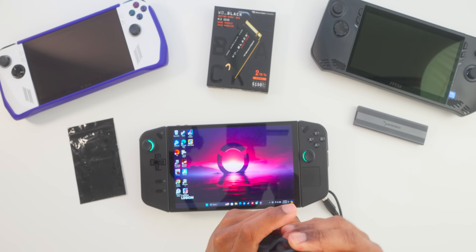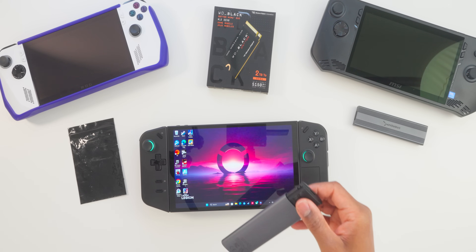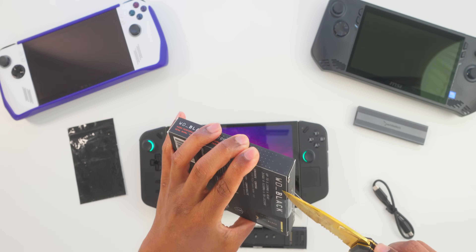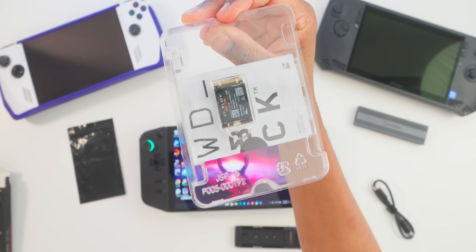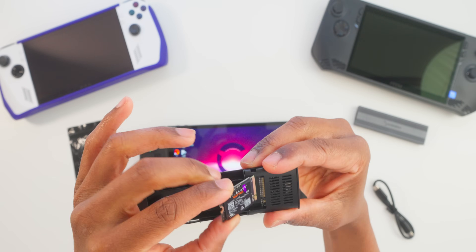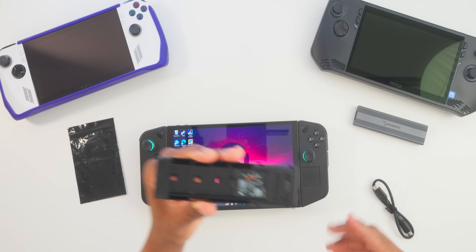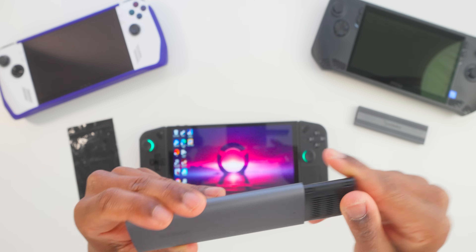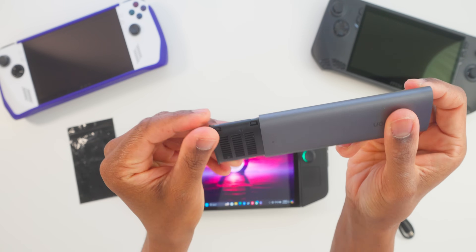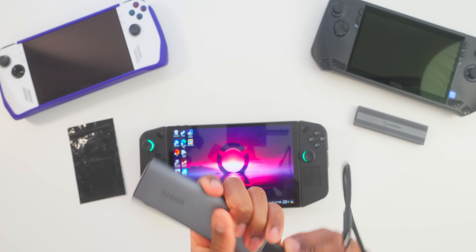Got our drive. With the Ugreen one, it's not as simple to get to if you choose to use the rubber exterior — you just press that and it pops out. There's the rubber stopper I was speaking on earlier. Let's unbox our two terabyte WD Black NVMe. It's amazing how small these SSDs truly are; this 2230 is quite minimal and compact. Let's install this inside of our Ugreen enclosure — remove the rubber stop, put it down to the correct sizing, and that holds it in place. There's an arrow telling you which way to insert. It does say 'push' right here, so when you're ready to pull it out, press right there and it pops out. Snap it back in. Now it's time to hook this up to our Legion Go and clone our drive.